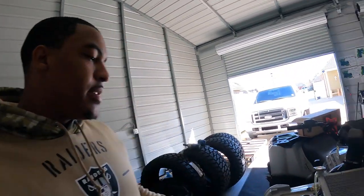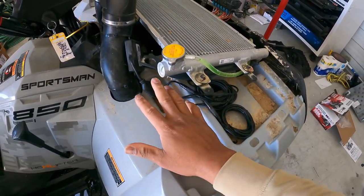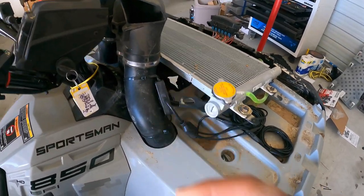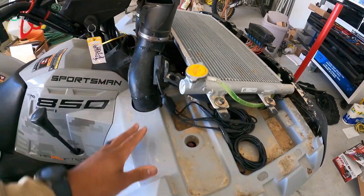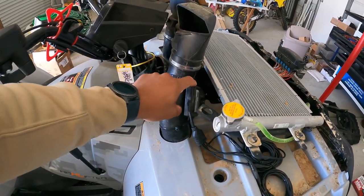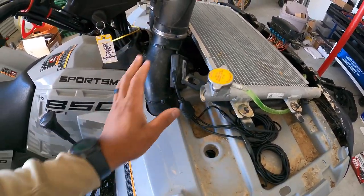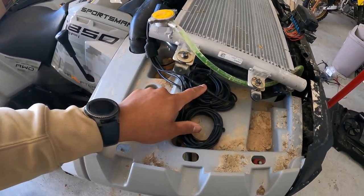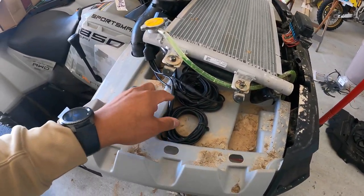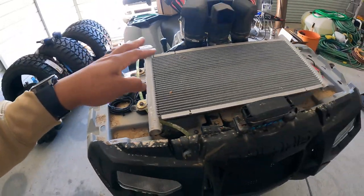But guys, check this out. Check the wiring out. We got everything ran nice and neat. Like I showed you in the last video, if you guys haven't seen it already, go check out part one. But this is our Bluetooth controller for our rock lights. We got it mounted up here as high as possible. All our wiring up here, we shrink wrapped everything, and then taped all the ends as well, to try to keep moisture and everything out of those.